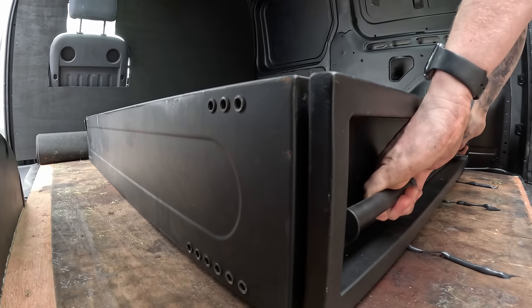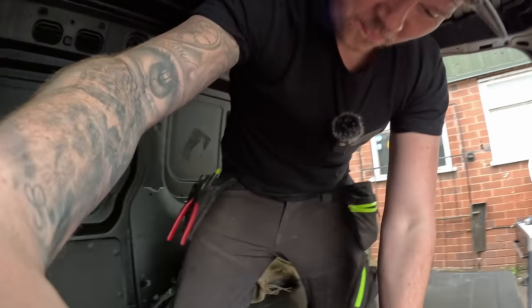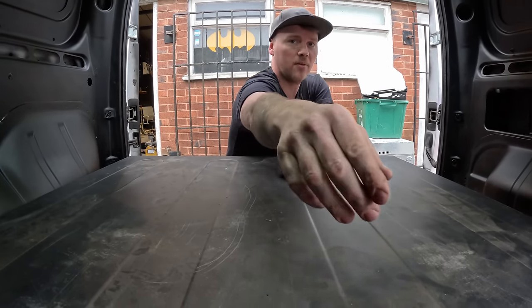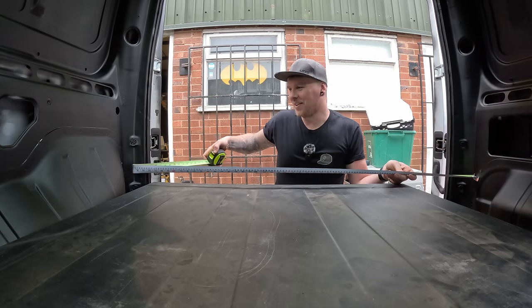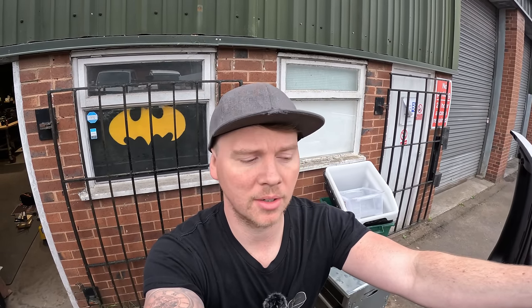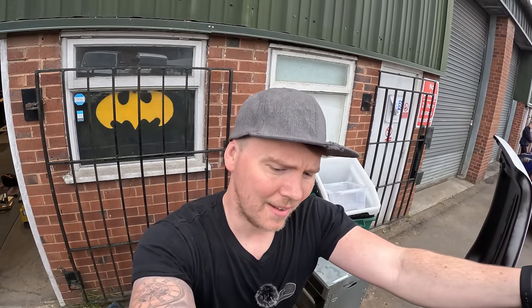Using all 17 stone to compress it - job done. Now we're going to measure the top. The ply will come and shear down on the far side. It's 120, but we want to go to the point where it touches the van - that's going to be 120 by 143. I've had a look on my phone at van rack ideas and pictures, but I'm pretty much just going to wing it. We'll get a sheet of 18mm ply cut down to roughly what we need, jigsaw around the wheel arches, fix down, get the matting back on, and then go buy probably two sheets of 12mm ply.